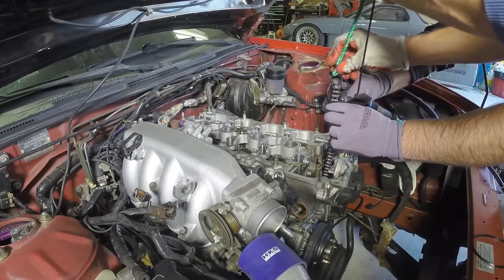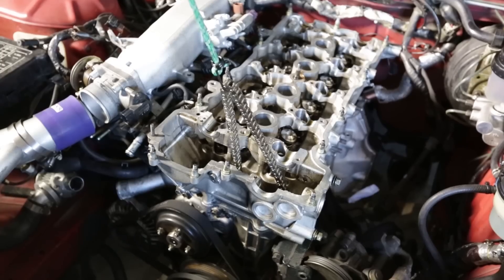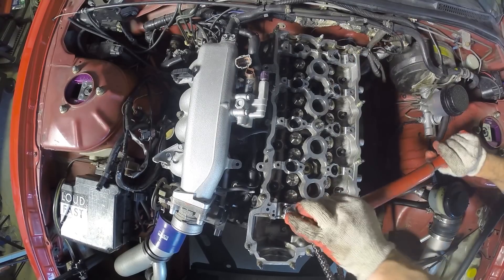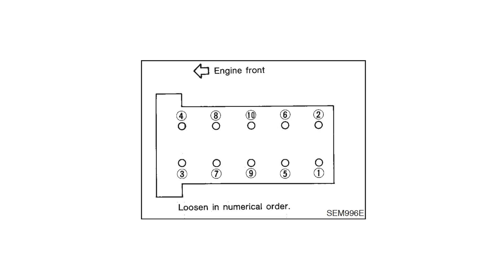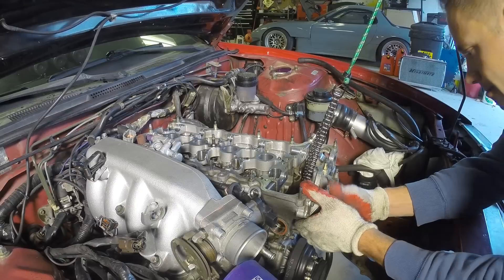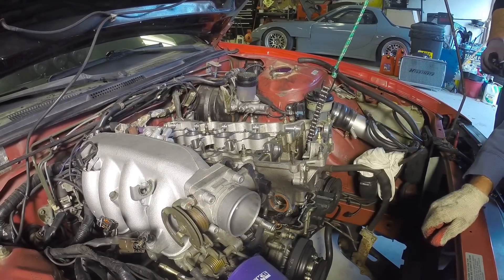The bungee cord holding up the chain is for my own mental well-being. Apparently you can drop it down and the chain won't slip on the crankshaft, but me being the paranoid type, I simply hold it up with the bungee which keeps the tension on until I'm ready to remove the head. Get the pipe extensions out for the ratchet because the cylinder head bolts are going to be tight and require some serious force to crack them loose. There's a proper procedure to loosen the head bolts so make sure you follow it, otherwise head warpage could occur. It's almost time to pop the head off, but there are two small bolts on the exhaust side of the head that you have to remove first.